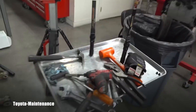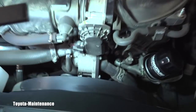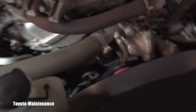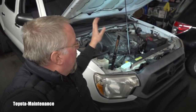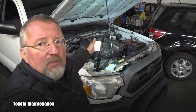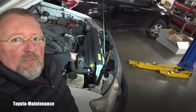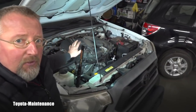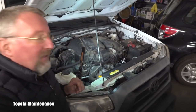I started looking inside with the engine idling and I need to make sure everything is perfect with no presence of coolant. Unfortunately I see coolant suddenly all over. When you look for these problems it will most likely not show up when the engine is off — there's no pressure. It needs to be running. One warning: there will be moving parts, there is the cooling fan, so if you're looking for a leak yourself, don't lose your fingers by sticking them down there or getting grabbed by a belt.